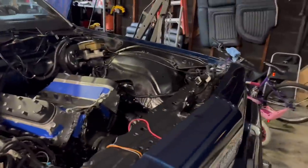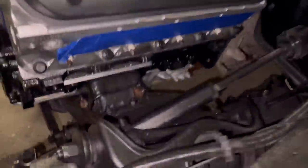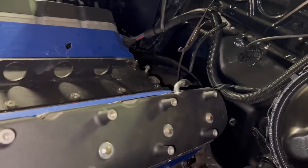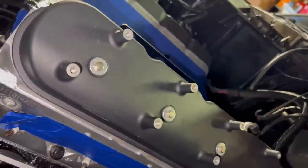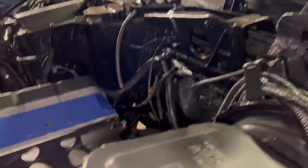I'm going to put the crossmember in. Since I took the other one out, I'm going to probably put the crossmember in, because that's why the transmission is slanted a little bit. You see I put the brackets forward — that way I can have more space back there so when the intake and all that stuff goes in, I have a little more room to work back there. I got it all the way back. I could move the motor back a little bit if I want to, but I want it right there. I'd like to have a little room over there in case something needs to be done, I can get up in there. But we're good to go on that.